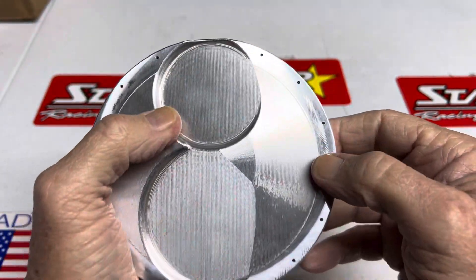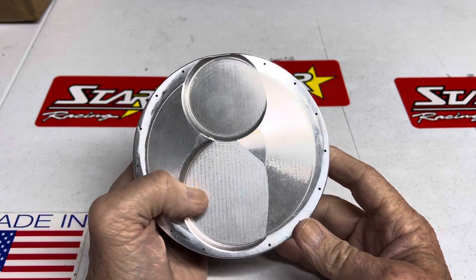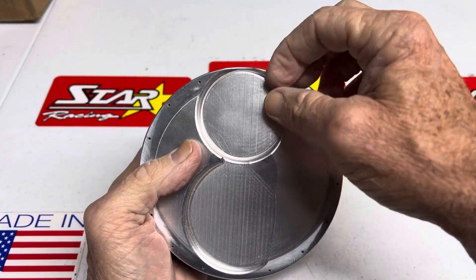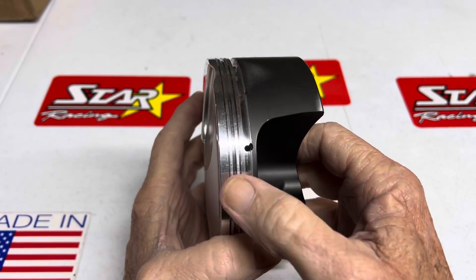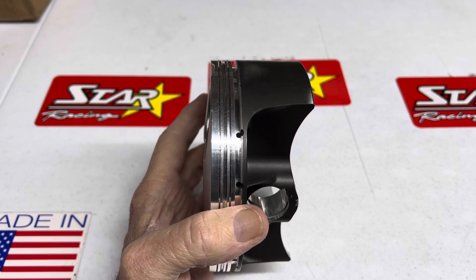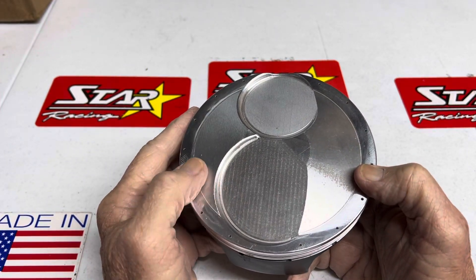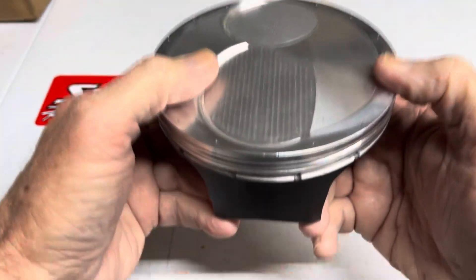The second thing is all these people worried about gas ports on street bikes and street engines. It is so much better when you use gas-ported pistons and a nice thin ring — it gives you less wear on the cylinders. People say gas ports give you a bunch more wear because they put combustion pressure behind the rings. Well, you want that, but listen — combustion pressure is only a little bit of the 720 degrees that the piston goes up and down.